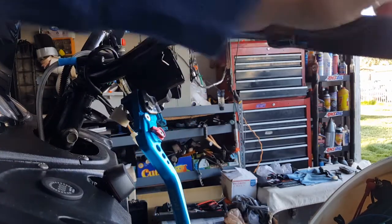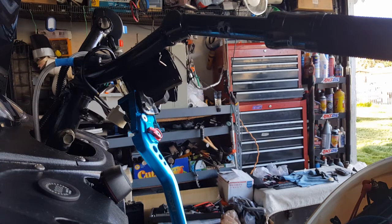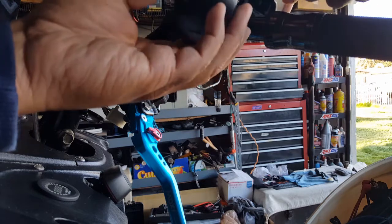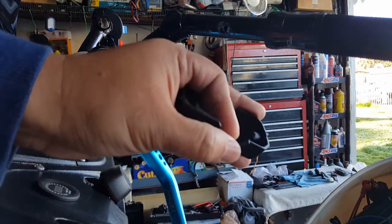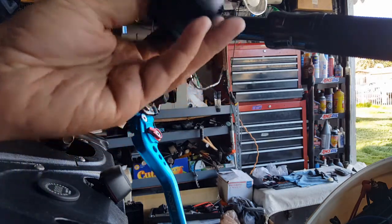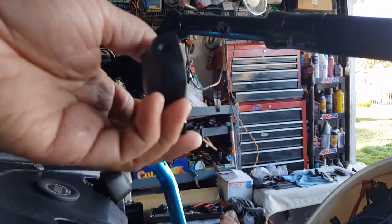I'm glad I got it — $20 ain't bad. We spent probably almost an hour trying to fix the teeth on the old one. Sometimes things are not worth it — just replace them. That's what's great about scooter parts: some are reasonably priced and made in mass quantity. So there we go — we got our teeth here, you can see the teeth are actually powder coated, so it's probably not going to stick to our JB Weld. That's fine — we just want the JB Weld to fill in the crevice area.